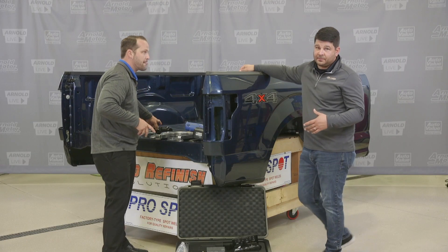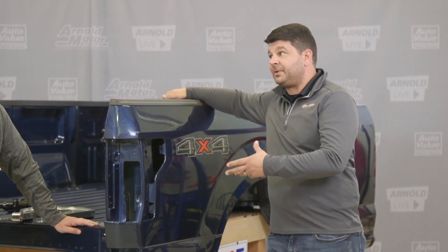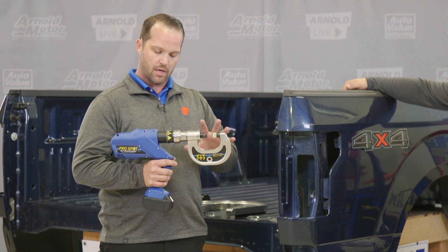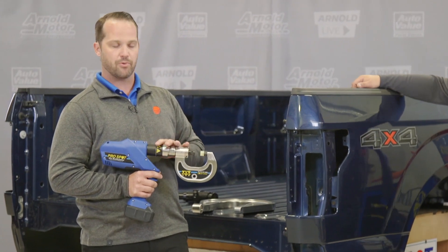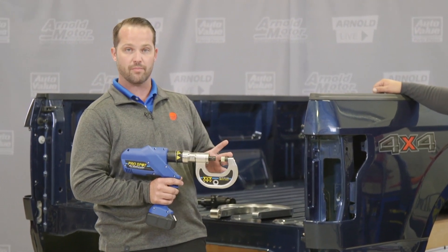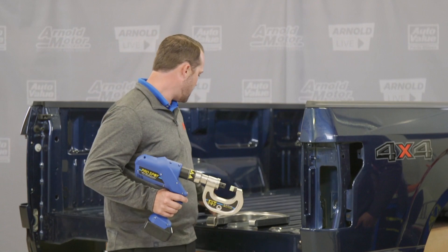A side note: some shops have already purchased a battery-powered rivet tool — whether it's a Henrob or ProSpot. ProSpot makes an adapter kit for that. If you have a Henrob gun and you're a Ford shop, you'll notice the casing is similar but the whole front is completely different. We have a conversion kit for the Henrob gun — you can call ProSpot or your local rep and we'll send out a kit. You change out the whole front nose, and because they have the same tolerances and squeeze pressures, you can take advantage of the additional arms and the blind rivet adapter to make it more useful and profitable for your shop.